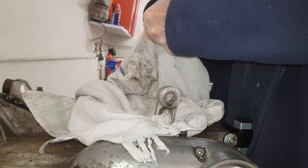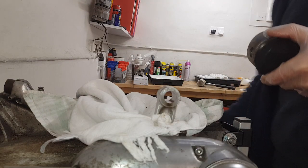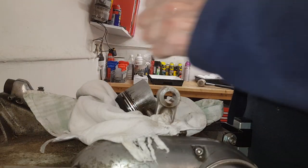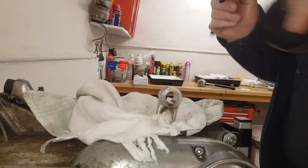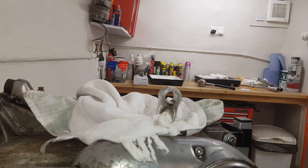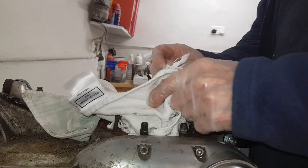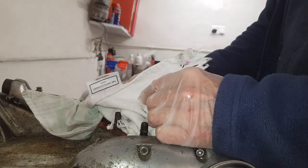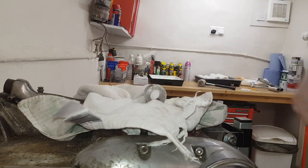There we go - not too hot - and off it comes. That's all three pistons off now. I'm going to mark this one just in case we get to reuse them - I don't think we will, but it's always good to mark them. That's 'T' for timing side. So all three pistons are off and we're going to have a closer look and then try taking off the main bearing caps.